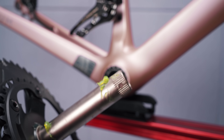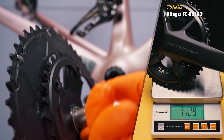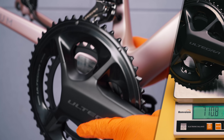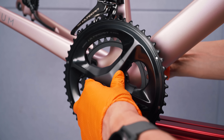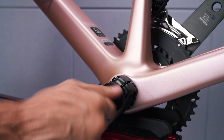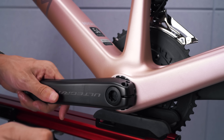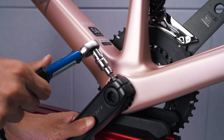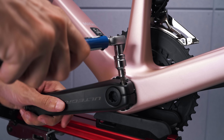Since it's a Shimano crankset, I thought it was only right to use some Shimano premium grease on the crank spindle and the threads. Mostly I've been using some Park Tool grease this far during the build because that's what I have most of — but it really doesn't matter for these parts, as long as it's grease. Non-drive side crank on and the preload nut finger tight to remove any play. Safety tab down, then alternate tightening of the clamp bolts up to the recommended torque of 12 to 14 Nm.